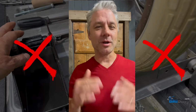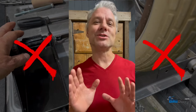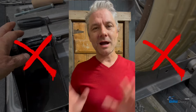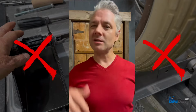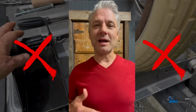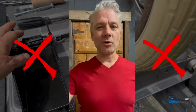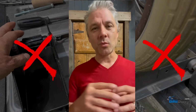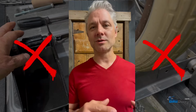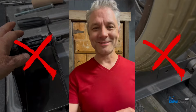Hey, Precautionary Tony interrupting for one second. I've got the red shirt on, saying warning. I want to talk about how to use this bicycle engine properly. We have way too many people who want to hop on this, roll the throttle back from a dead stop and expect it to go. It's not designed to be that way. So what you do is you start the engine, you let it warm up properly, you get on the bike and you start to get some miles per hour going, okay? So get cruising just by pedal power, roll that throttle back and enjoy your ride. Never ever just start from a dead stop because you're going to wear out the drivetrain parts. Those aren't covered under the warranty. So please, use it properly and you'll enjoy it for a really long time. Now back to the programming.